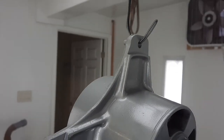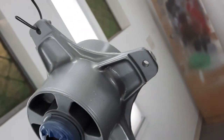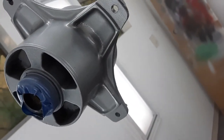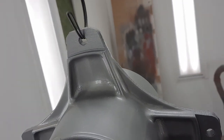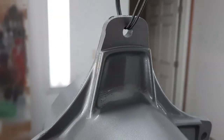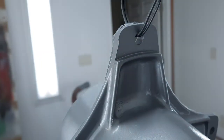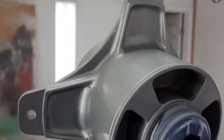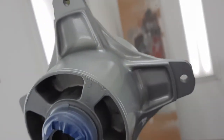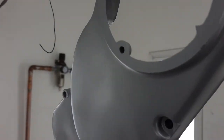You can see it shining - that's all I want to do is just get to a shine. I don't want it super thick. I've had problems where I put it on real thick with a lot of clear - when you bolt down and put a nut like in a side cover, it cracks around the hole where the bolt goes. So there's that, and there's quite a difference. Here's the first light coat on the side cover - you can see there's just no shine yet.